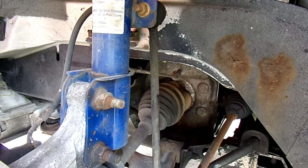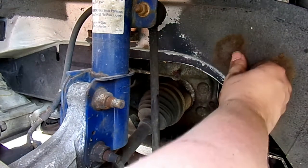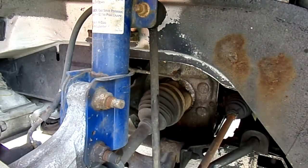What I did at the time because I didn't have a Dremel — I took a pair of channel locks. The ones that once you squeeze them shut, they're shut until you hit a release lever. Because the old one was off, I was able to grip the actual ball joint head piece and lock it in place with the channel locks and slowly get it off. And I just found more rust — that's going to be fun.